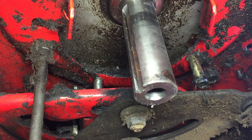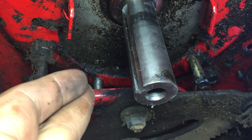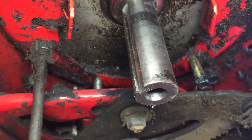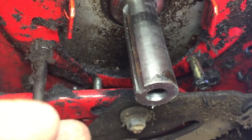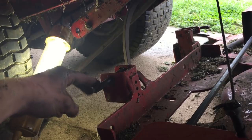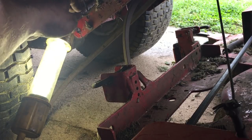Now that we have the engine pulley removed, we need to feed the belt onto the pulley, put the pulley back up and feed the belt between these two pieces, minding the pin. The drive belt will need to go in between the pins. I lowered the deck on my lawnmower to give me more working room — I had to put some WD-40 on this spring and pin, then slide it straight out to release it and give me a bit more room.